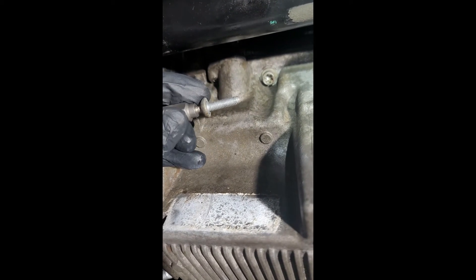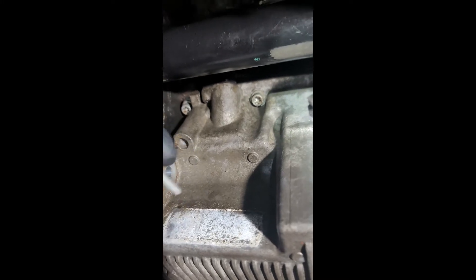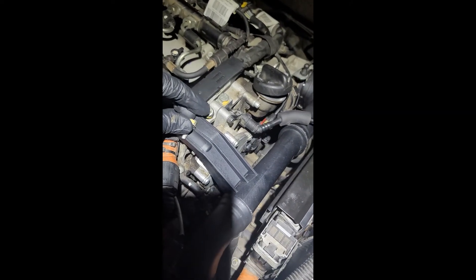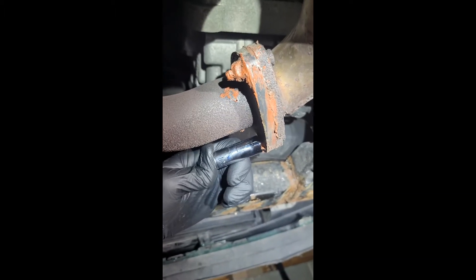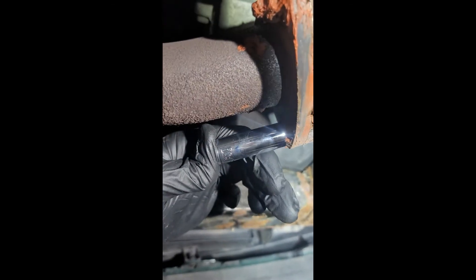If you have to do the same, I'll show you where to grab a similar bolt on the top of the engine so you can drive to the hardware store once your car is running and get a replacement bolt. On the top of the engine right here is a very similar bolt — same length basically — and this one is a 10 millimeter. They're basically identical; one's 10 millimeter and the other one is unknown. Next, I'm going to be pulling down the exhaust — there are just three bolts at the flange and they're 13 millimeter.